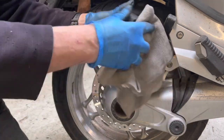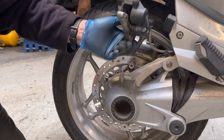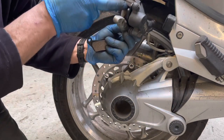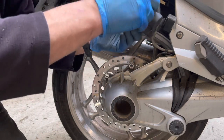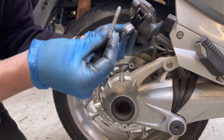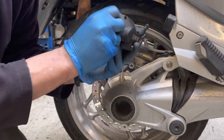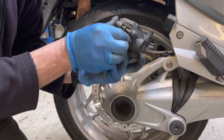There we go, they've gone back as you can see. Now we're going to reverse order — put the pads in, one in there. There's a small cutout right at the end, make sure the spring is in there. That just pushes in nice and there. The R-clip slot wants to be on the top — you don't want it at the bottom because it's the wrong place to put the clip in.